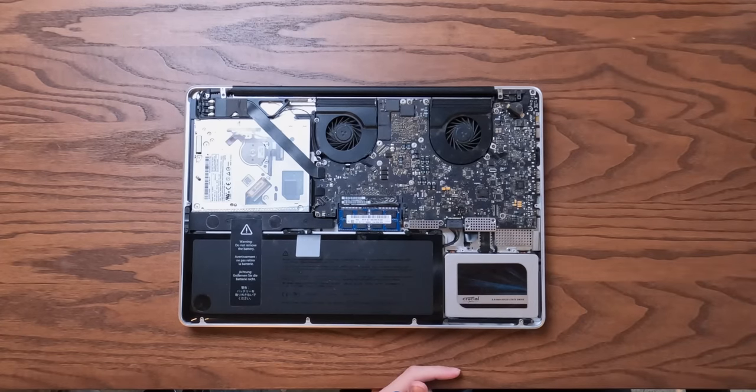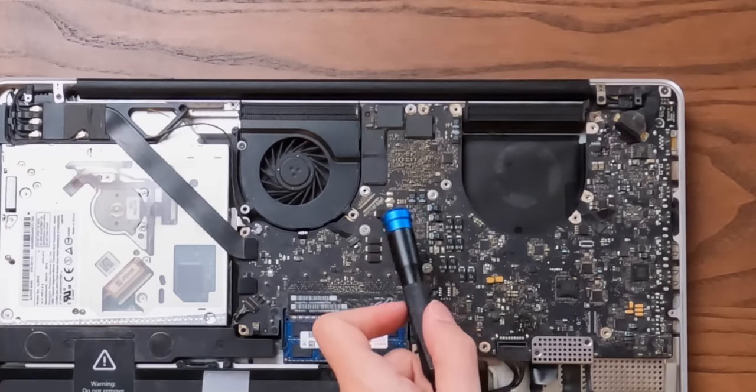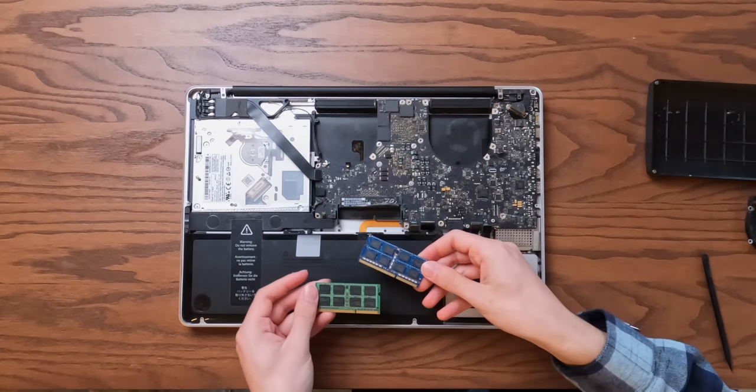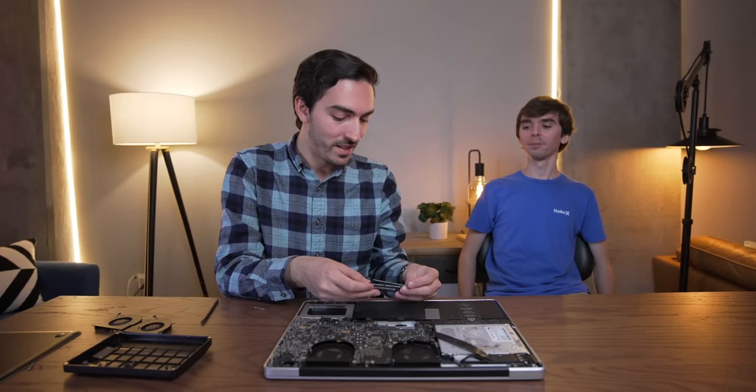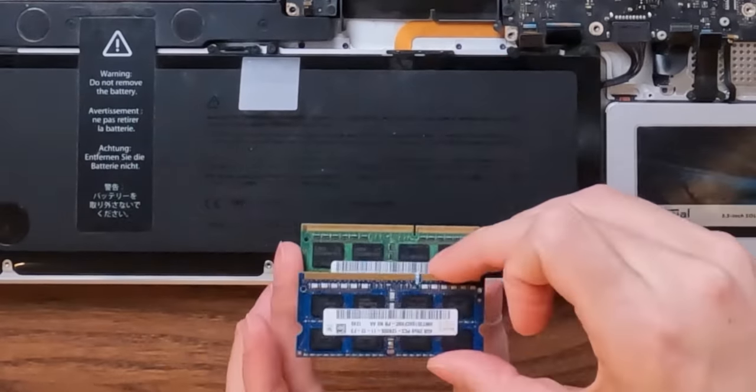This is the laptop that Apple never made. They never made a 17-inch for 2012, and I think that's a real shame. I want to see what this thing looks like in person. It looks pretty normal in here. In fact, those are the original VRAM chips that are no longer doing anything — but I left them on there. The mismatched RAM — like only that combination would work with CoreBoot. The blue one has to be on top. That one's 1600, the other is 1066.